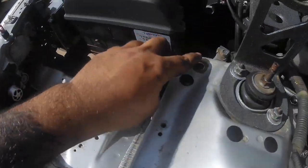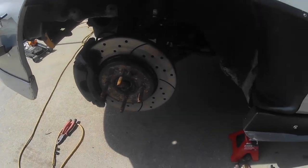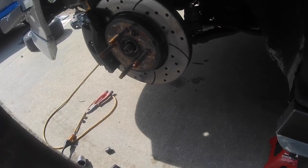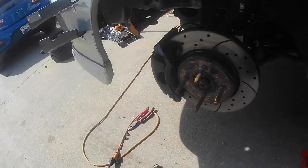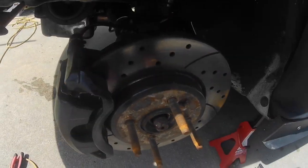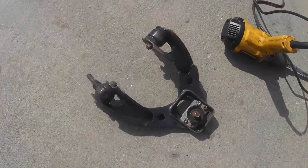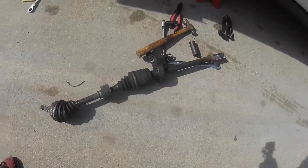I already undid the top bolt for the upper control arm and I'll pop these two off right here — so this control arm is about to pull out. I have to pull the axle out in order to undo the lower ball joint because of the allen key in there. I'm going to pull all this apart and then get ready to install that lower Skunk2 arm. Progress update: upper control arm is off, axle and intermediate shaft are off.